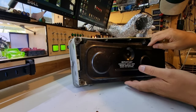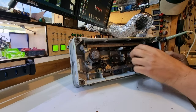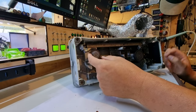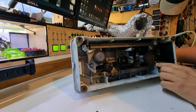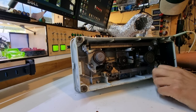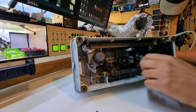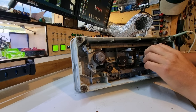We've definitely disconnected the power supply. This one has a belt drive — that's interesting — and the belt is a little slack. The bobbin drive is not consistently driving this belt. Something's kind of loose in here. The cam is engaging, but it's only intermittently driving. That feels like there's a stripped gear in there.